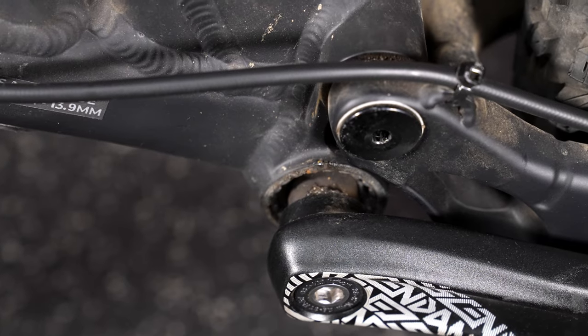Let's talk about some of those components. Something that caught my eye — I kind of thought we were done with this for bikes at this price point. Several thousand dollars, and it's got an internal bottom bracket. Can you explain some of the drawbacks of the internal bottom bracket and why almost as an industry we moved away from it? Basically, the internal splined bottom bracket's bearings don't last as long, service isn't as easy, and everything else at mid to high-end bikes has an external bottom bracket.